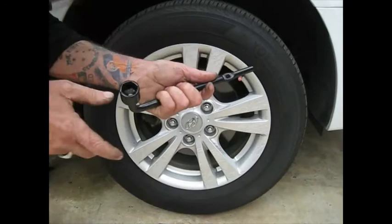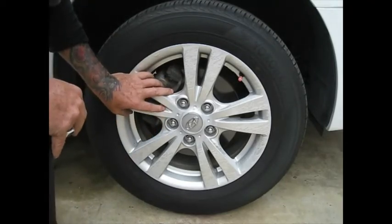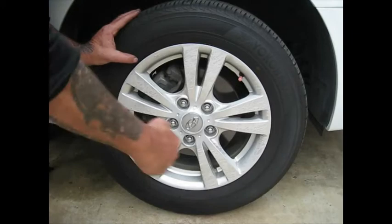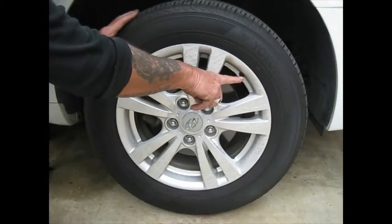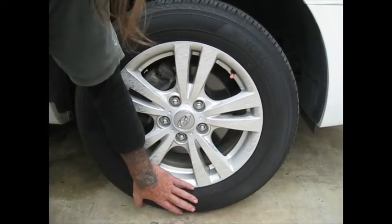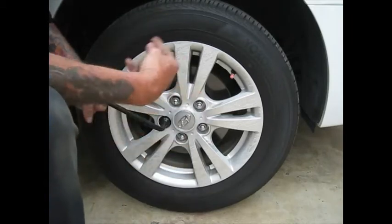This is what we call a wheel brace. Now, this car has mags on it. A lot of the cars you girls drive will have a standard rim, and they have a hubcap here. They'll usually give you a tool that you go in, and you just prise your hubcap off, and it'll just fall onto the ground. There also will be a slot for your valve when you go to put it back on — all you do is just put it on and smack it back on. Right now, you are still solid on the ground. You want to leave it there, and you want to crack your wheel nuts.